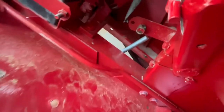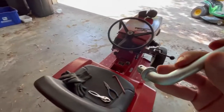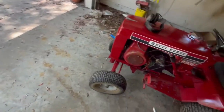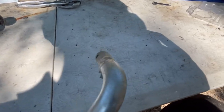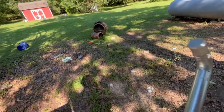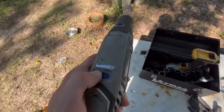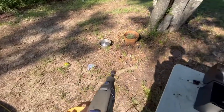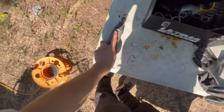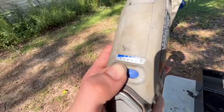Here is some not so good news — it has to connect in here and as you can see it's not anywhere near it. So we're gonna have to do some modifications to this lever. Looking at the old lever, it doesn't have that stopper that this one has, so it looks like we're gonna have to shave this off using my Dremel. This is going better than expected — I got most of it off, still gotta get this end right here. We got it trimmed off. Let's go to the wheel horse and see if it fits. We still need a little more sanding, and now my Dremel tool is not working — I guess my Dremel has had it.